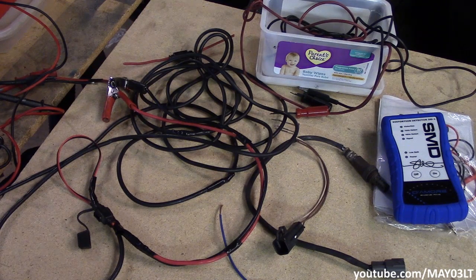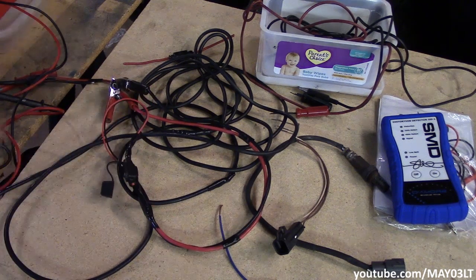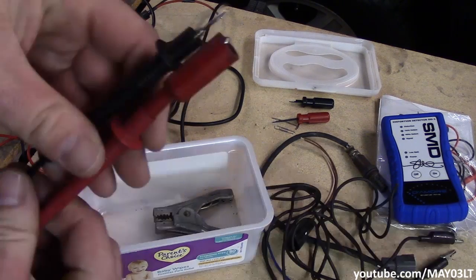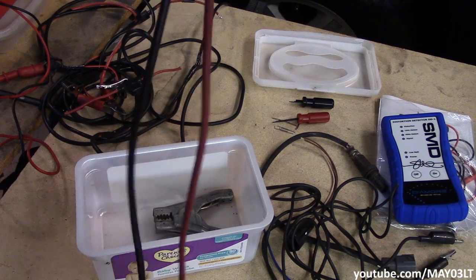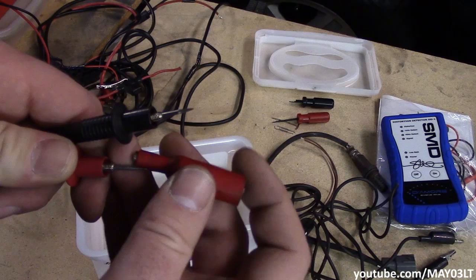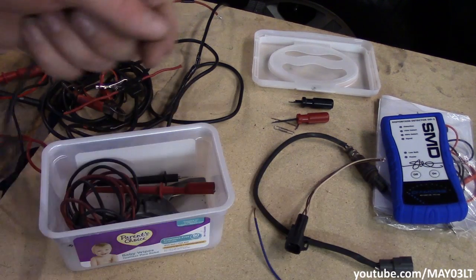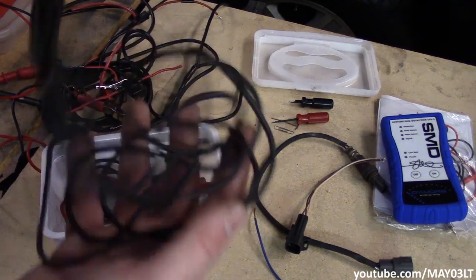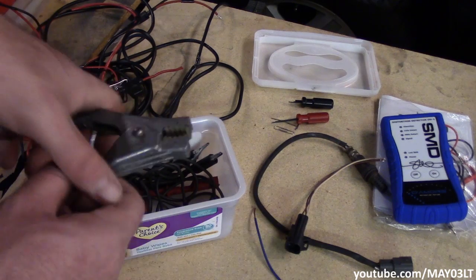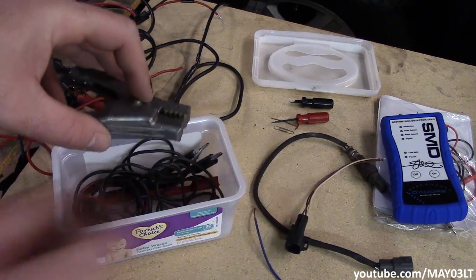When I did the tail light circuit board testing in the Trailblazer, I went off one of my rear batteries — well, 99% of Trailblazers don't have rear batteries. This would be how you could get power to your test equipment at the back of the truck. I also have a custom jumper made out of two DMM leads spliced together — inside the jacket there's just one wire, and it gives me a lot of versatility. I can have probes on each end or alligators on each end. The other one just has alligators on each end and is a pretty decent length. If I have a battery dying overnight, I'll take the terminal off the battery post, clip this onto the battery post, and one meter lead clips onto this metal clamp while the other connects to the battery terminal to read the amperage going through.